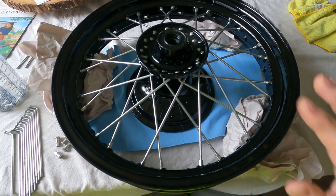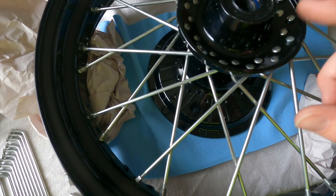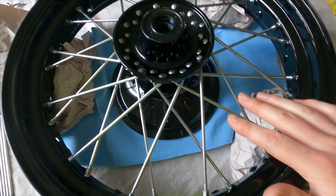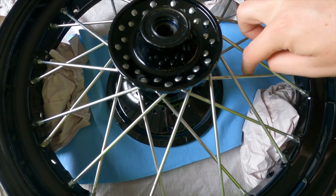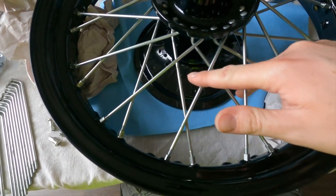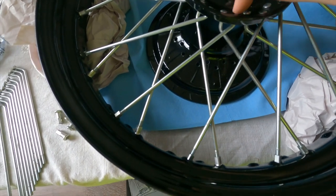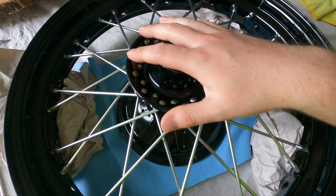I have all the top ones and all the bottom ones just lightly threaded on. You're going to notice the pattern — these two crossed right there, counting between them, that's four per each one. When you're putting the top ones on, just like this one here, you thread it down under this one, in front of this spoke right here, take it up and pull it all the way back. When you start putting these through, leave at least two not threaded — when you put this one on you have to pull those two out of their holes, push them over, put that one through, then thread those along.